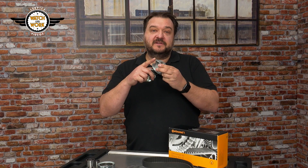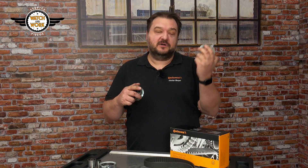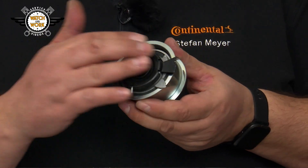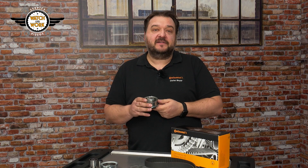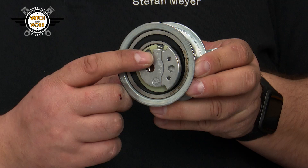A minor modification has been made here. One of the tensioner pulleys has a mounting plate that must latch onto the engine, whereas there is no mounting plate on the second variant. The tensioning direction has also changed, meaning we turn this pulley anti-clockwise to tension it, while the other is turned clockwise.